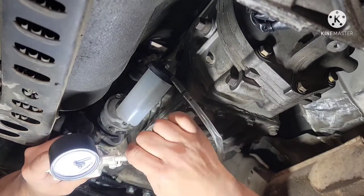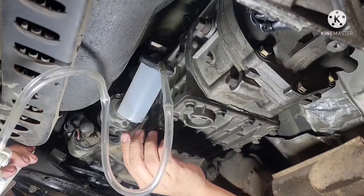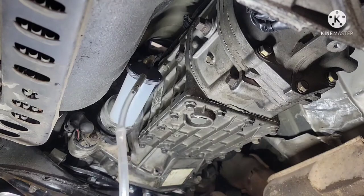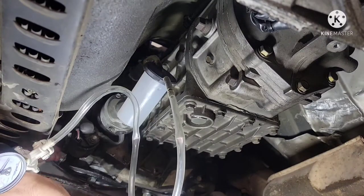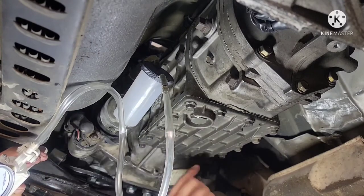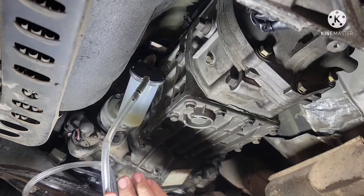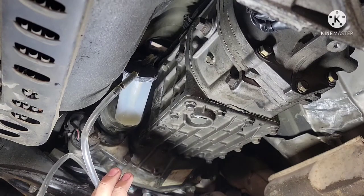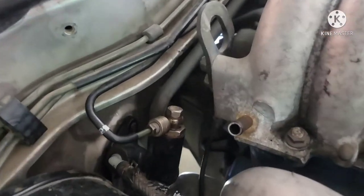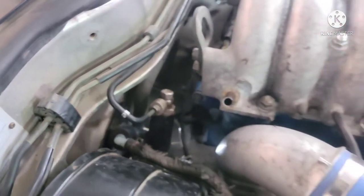Just keep the bleeder open and this will pull the air out of the system. When you see fluid coming out it will come to here — look, it's draining already, gravity is helping. I'm going to pump it now to pull the air out. Keep an eye on that reservoir to make sure it stays full. You can see on the clear hose that there are bubbles coming out. Make sure that banjo bolt is nice and tight with no leaks.